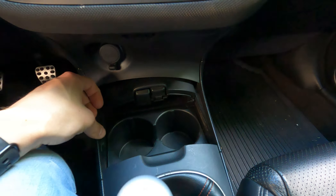For the back it's just two screws, one on each side, and then this baby will be ready to come off. Another thing the Type-R doesn't have is the cigarette lighter in the back, so make sure you unplug it before you take it out — otherwise you're going to strip some stuff. So I got it unplugged. Also here is the Acuity short shifter — I installed it before I made the channel. Pretty nice.